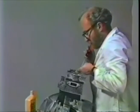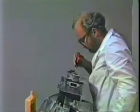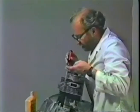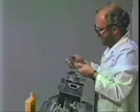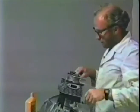Put the 4 washers over, one to a stud. Tap them down with a screwdriver. Get out the 4 used and replated head nut washers. Put them in. Push them down. Get out the remaining 4 head nuts, 3 wide brim and 1 narrow brim. Narrow brim goes on the left of the middle 2.